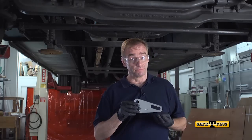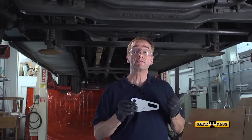Step 2 involves installing your mounting brackets. You'll install your anchor bracket first. This bracket will be installed on the left front side or driver's side of the vehicle. Make sure that the slotted side hole is pointing toward the driver's wheel. Other mounting kits on different chassis might call for mounting on the passenger side.